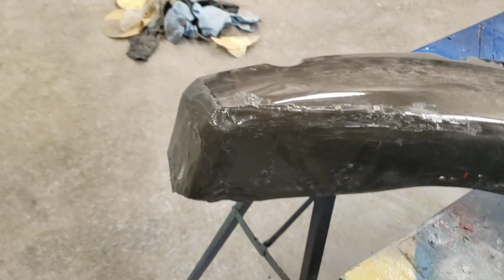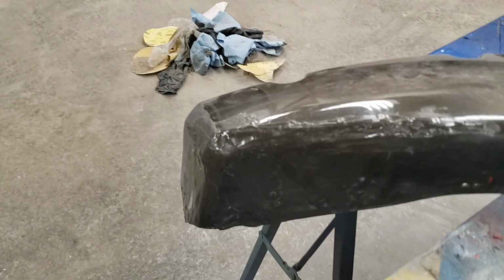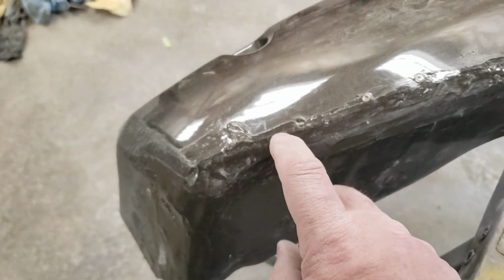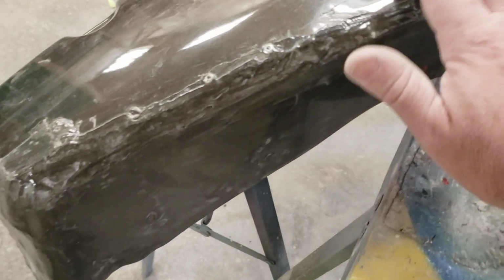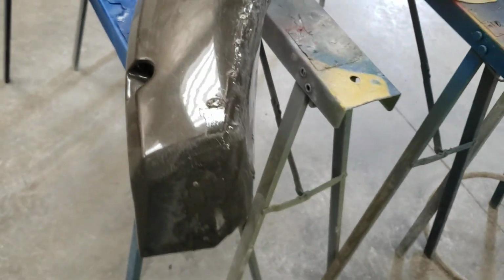And if we take a little bit of fiberglass Bondo or filler, and we're going to pour a little bit of resin in just so that it's stickier, we're going to go over top because that stuff will stick to this. This will glue fiberglass and filler. So when we put the filler on, they should be super duper compatible. And we'll flood this out and we'll kind of resand our shape in here. Same with the bottom. And that's what we're going to do.